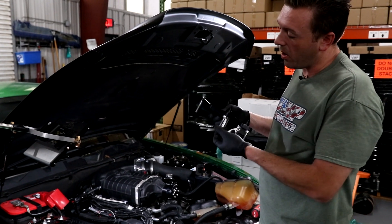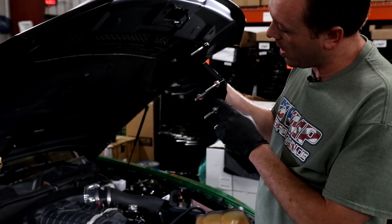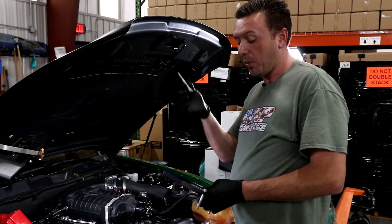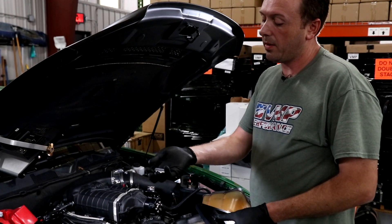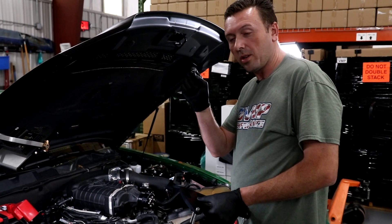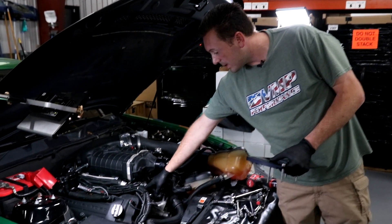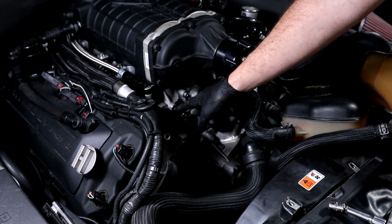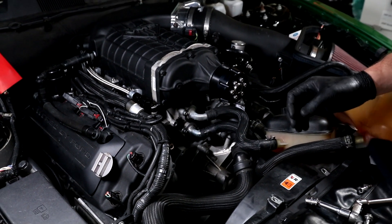All the bolts on the Bomber Bracket are M8 by 60 millimeters long. It's going to come with these standoffs already Loctited into the bracket. There is one longer 80-millimeter bolt that goes right here, and we do provide two standoffs that total two inches long and a thin washer — you may or may not need the thin washer, just test fit it and see how it feels. That longer 80-millimeter bolt ties into the intake manifold and gives you some additional reinforcement. It also gives you the ability to pull the bracket backwards or forwards a little bit if you have any belt alignment issues.